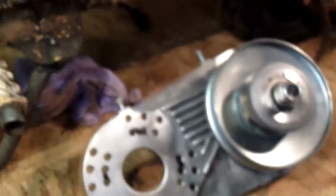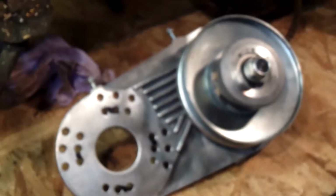Which was also neat was when I put the torque converter on, the sprocket and the rear drive sprocket actually line up. And I got a little adjustment forward and back. But one problem I got now is this thing, torque converter, sets a little high, like I said in the last video, and might need a chain sprocket here to get the chain to go below the rear arm here.